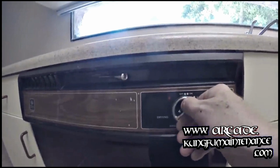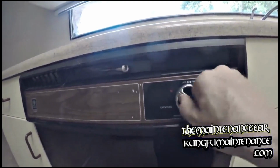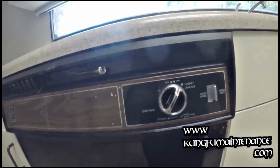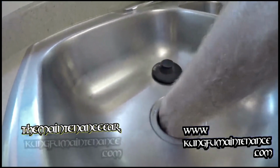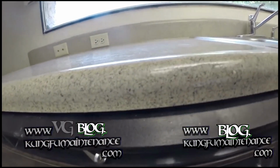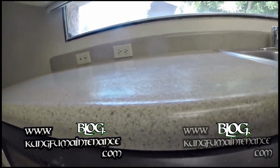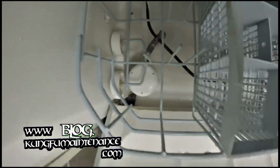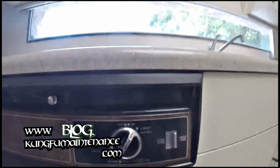Okay. And stop the fill cycle. So I'll put it ahead to the drain cycle. Anyway, if the water did not turn off properly, then that would mean we just pull that apart, pull the screw off, and clean out that float cap switch. A lot of times it's just soap residue builds up and hangs up on there.